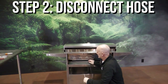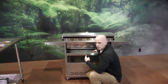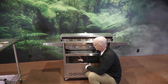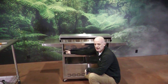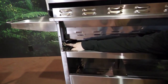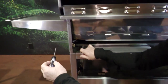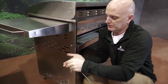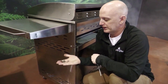Now that we have the rear panel removed, you're going to want to slide the heat shield over if you had it installed. You do not need this when using natural gas — this heat shield is strictly to protect your tank. Next, there's a little bracket that holds the gas line inside, so we're going to remove that bracket to allow us to remove the front faceplate.